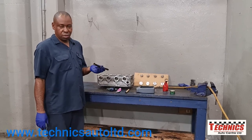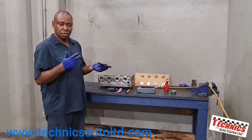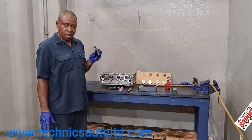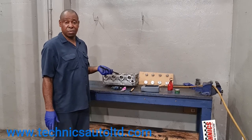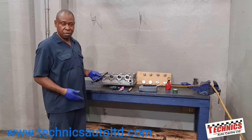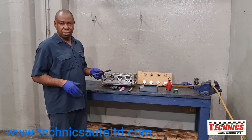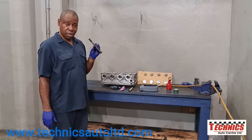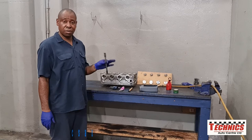With the drill it keeps going in one direction in a circle, and even though you can reverse it, it just doesn't give you the finish I'm looking for. So I prefer to use the stick. I only use the drill when it's absolutely necessary, or if the valve is in a bad state and needs a lot of grinding - I'll use the drill for a first cut and then use my hand for the finish. But with these valves we're going to use the stick all the way.